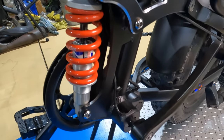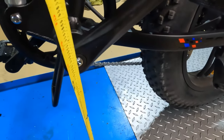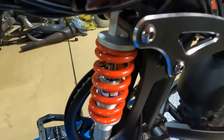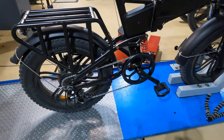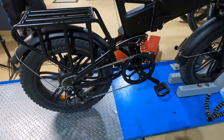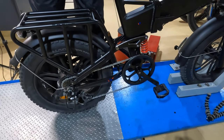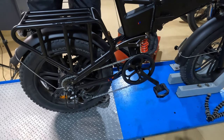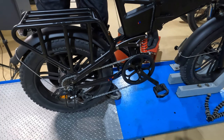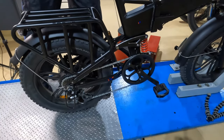Here we are on the other side — this is just the little rounded notch we put in there. Here's the shock on the bike. Everything's bolted together. I used blue Loctite on the bolts when putting them back. The bottom bracket height is now right at 13 inches — we gained just the half inch that was the shock length as far as rear height. This RockShox has a 500 pound spring on it. Let's see how that works. Oh, that's way better — I actually got some suspension now and the dampening is pretty nice. There's also an adjusting ring on the bottom; tighten that nut and it adds preload to the spring for a stiffer ride.